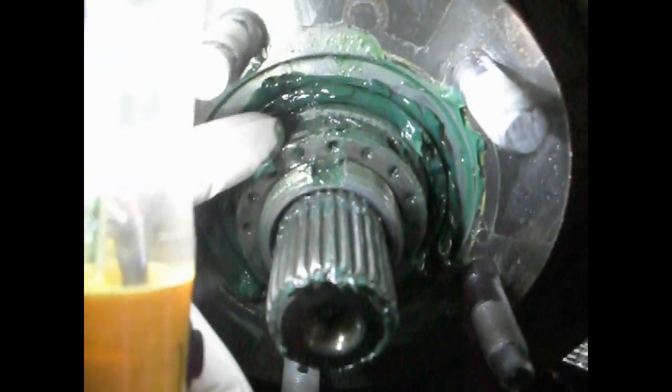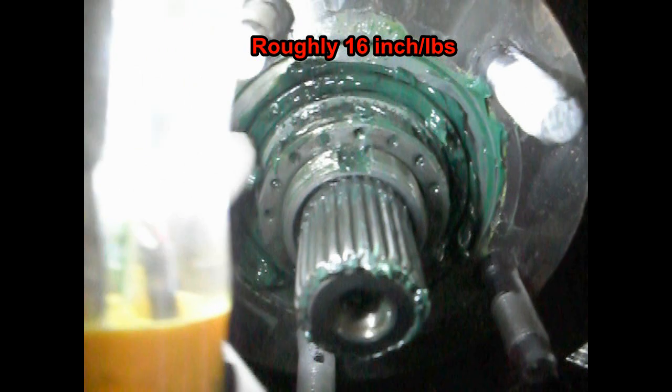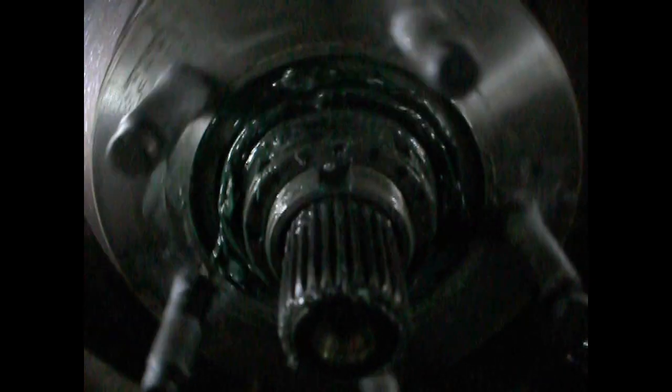and that's going to allow for the extra play that's here, while I tighten up the outer lock nut and this whole thing moves and ends up tightening up the inner, it'll still sit at about the right area that I want it, because you don't want this to be tight at all. You should still be able to move it quite freely by hand like that.